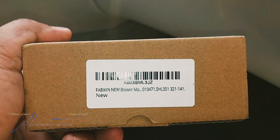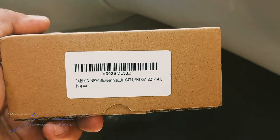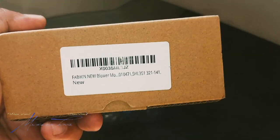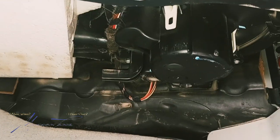What's happening everybody — y'all know what time it is. I got Big Boy and Turkey here with me, and today we are working on the Mercedes-Benz replacing the blower motor regulator. Here is the part number — this is a brand new regulator. The reason we're replacing it is because the AC stopped blowing, and when we pulled the code it pretty much said the regulator went out.